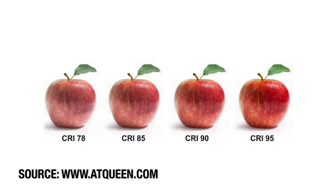If you have a CRI like this light — a color rendering index of 95 — it's going to illuminate colors naturally at a high index. To use something you can see, for example, an apple: if you use a color rendering index of 80 or so, you'll see the red around it and it'll look good. But a CRI of 95 will pull out all the colors and it will look very clean and pristine, which is very powerful for a light that's this portable.